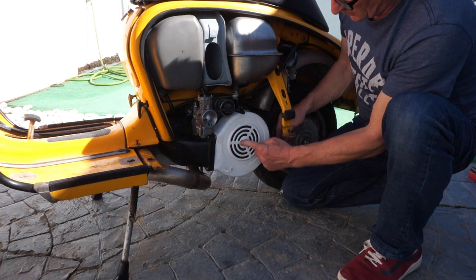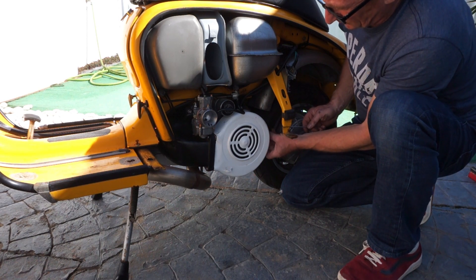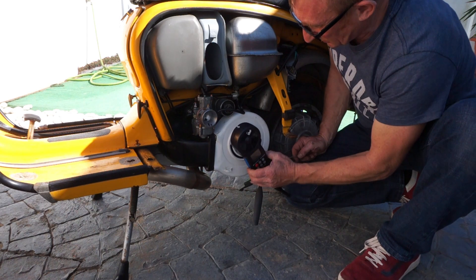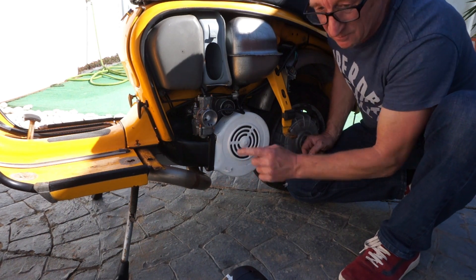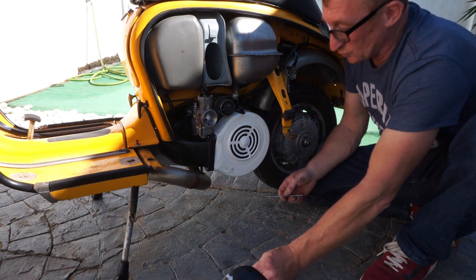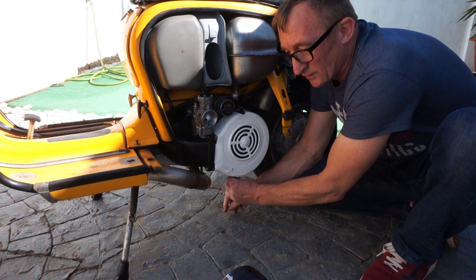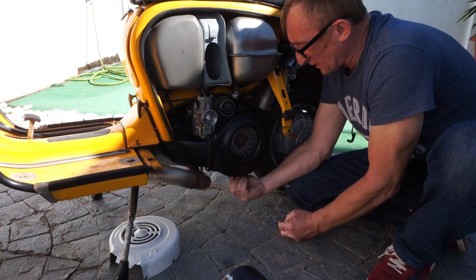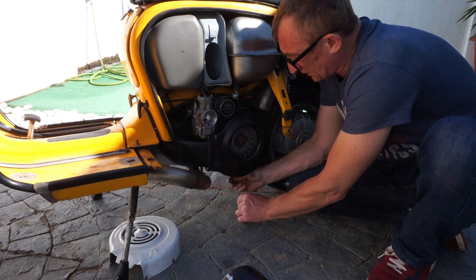This one was kind of a dismal failure. Even though I thought it could have the effect of higher velocity, with the fins here increasing the velocity — but it wasn't. It's actually an obstruction, and that's slowing your airflow down, and we've now got proof. Because they've just got fewer fins, they're wide and low, and they're even angled towards the middle, so it makes them even less efficient. Surely when you design something to be a performance item, it should actually improve the airflow, not decrease it.